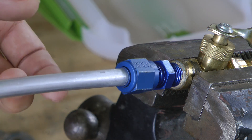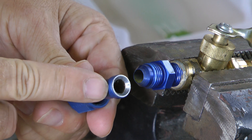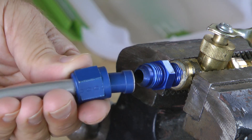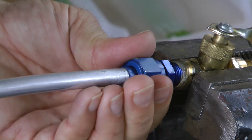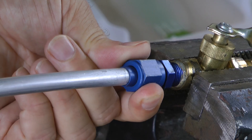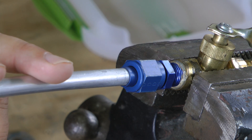Good question. Is it really crucial that the tightness be just right? The answer is yes, because the material that gets compressed on the flare can't be squeezed too hard or it will leak, and if you don't squeeze it hard enough, it will also leak. If we over-tighten too much, we also risk cracking the aluminum nut or fitting underneath. So proper tightness is key to a reliable leak-free fitting, whether it's fuel, hydraulic for your brakes, oil, or maybe for an oil cooler.